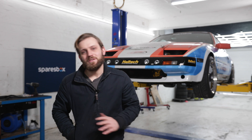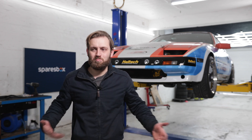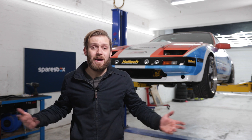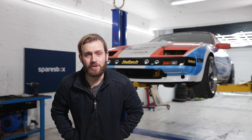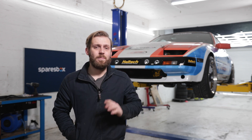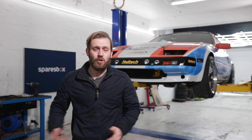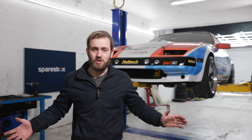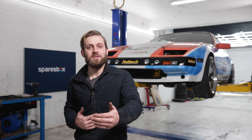Number one for me is the front sway bar. Aftermarket front sway bars with Z31s are few and far between - let's just call them unobtainium. Now while you can run a car on the racetrack without a sway bar, a sway bar is a fantastic tool on any sort of race car because not only does it allow us to work the tyres hard - it acts like a spring between left and right on the vehicle - it also allows us to fine tune the front and rear balance of the vehicle.